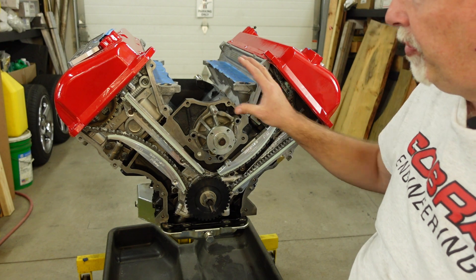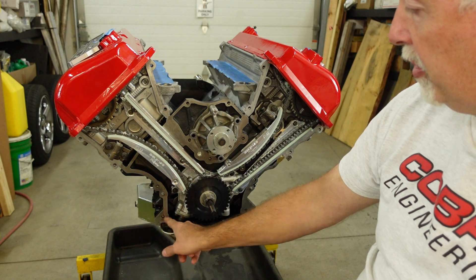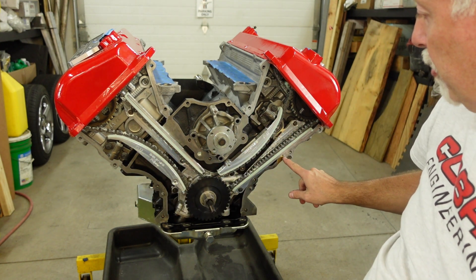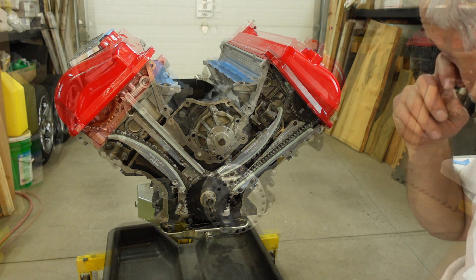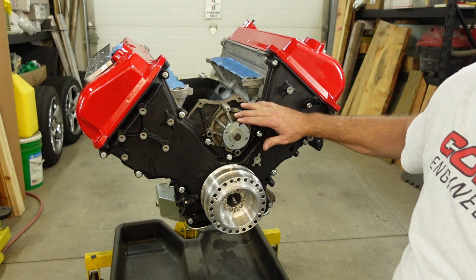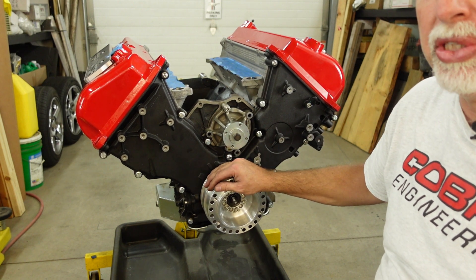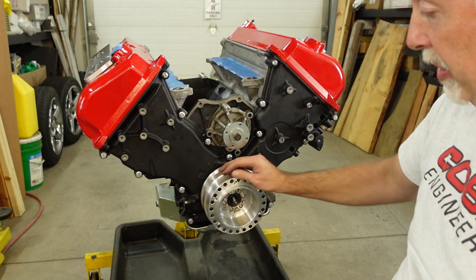Now I'm going to put the front cover on. Don't forget your dabs of RTV in six spots — not including the valve covers. These four are regularly forgotten by people because you can see where the head gasket gap is there. Don't forget that when you put the front cover on. Here you see I buttoned it all up — this is in the video on how to put a front cover on. How to put a dampener on: use the appropriate tool. Don't use the impact — or at least don't tell anyone you used the impact to put it on.